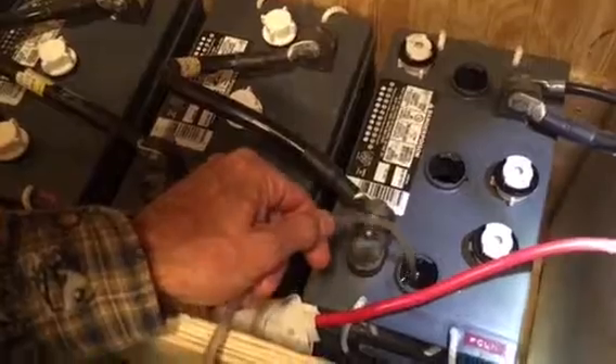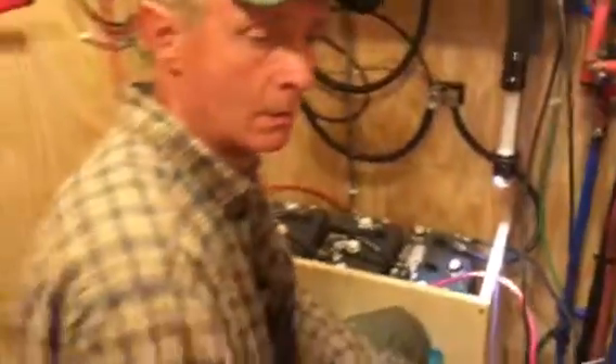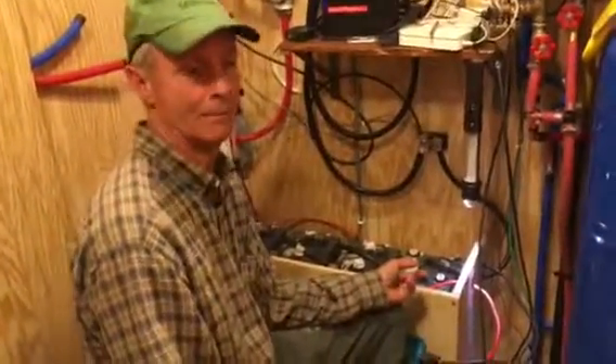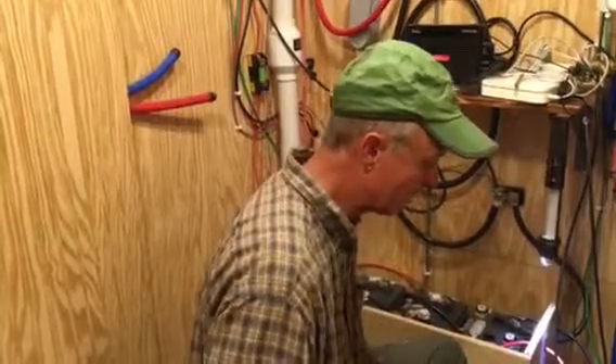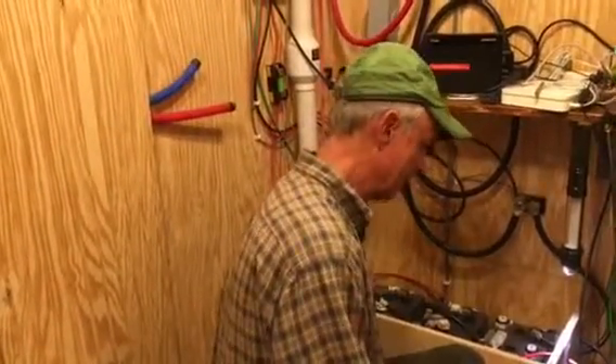I try to keep the batteries clean and avoid spilling any liquids around. Once they're full I always cap them off, because batteries can be quite unpredictable — there's a lot of chemistry going on. I've heard of batteries exploding or the contents getting too acidic. The instructions say you should wear goggles like the ones from chemistry class, because even when you're pulling the hose out of the cell it can flick quite acidic water at you.